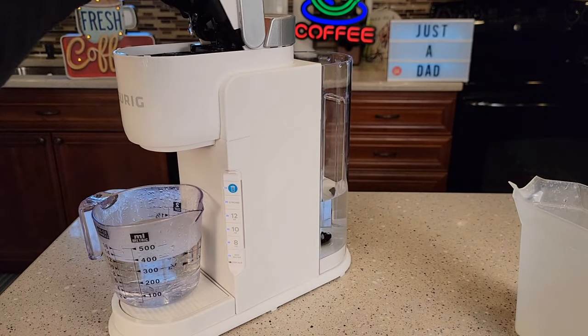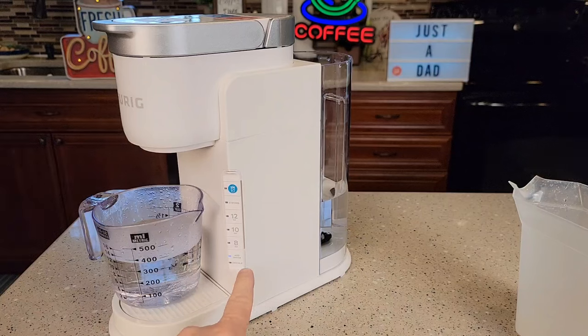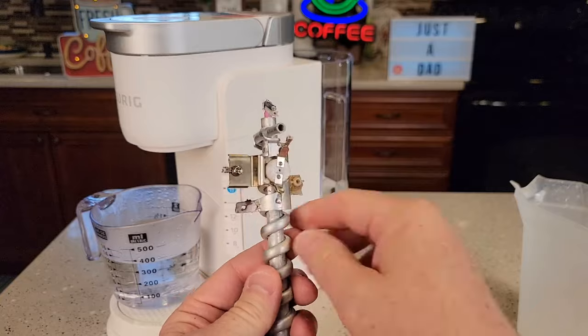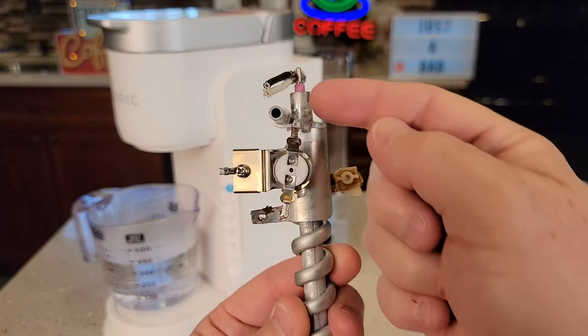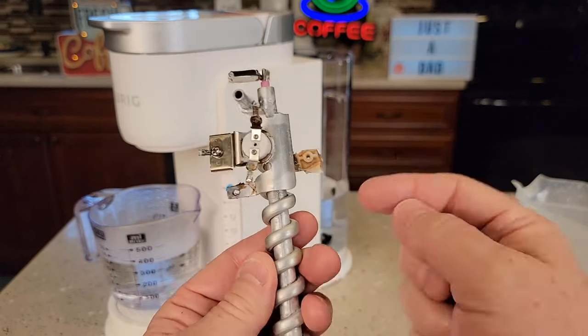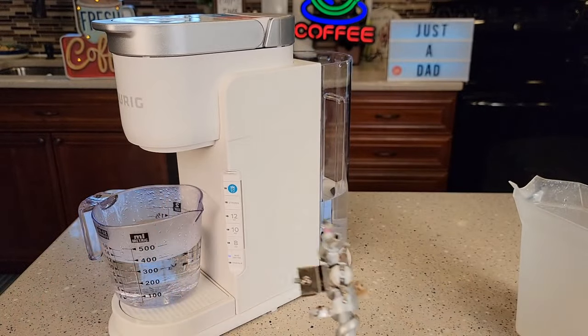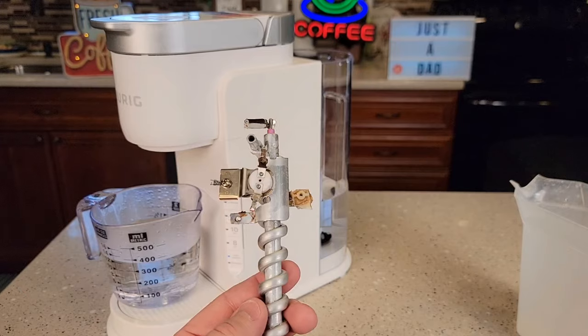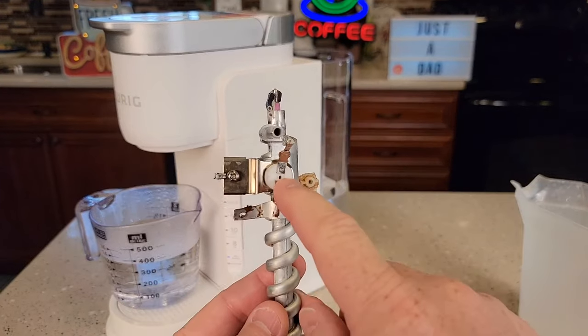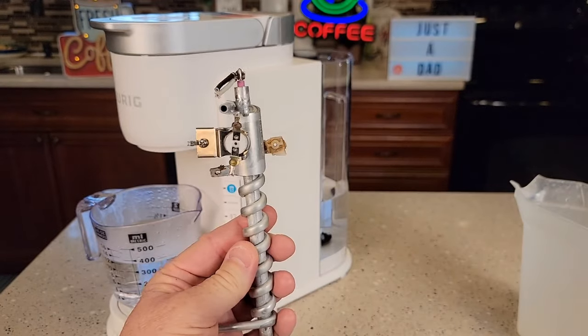Now you can fill your water reservoir up. My add water light is on — the circuit board saw the add water light and turned the descale light off. The reason we descale: here's the heating element out of another Keurig. There's the opening where water gets sent through and gets heated up. Hard water deposits can close that off, so you won't get as much coffee and your water won't be as hot. If your unit trips and loses all power, there is a thermostat you can reset with a paper clip, which I show in another video.